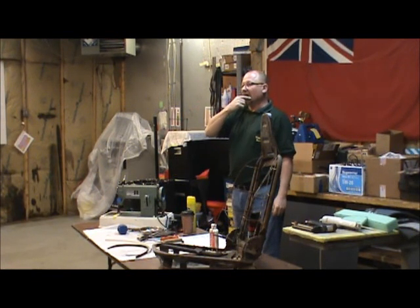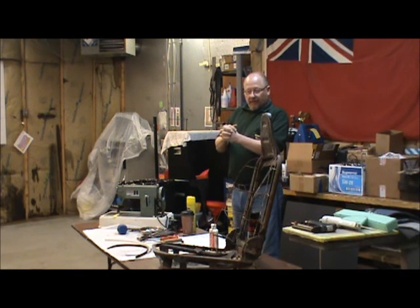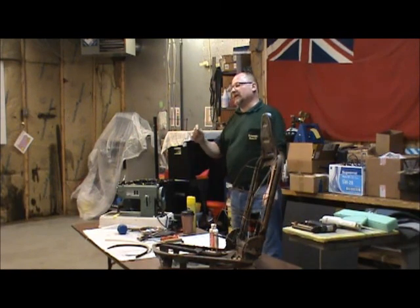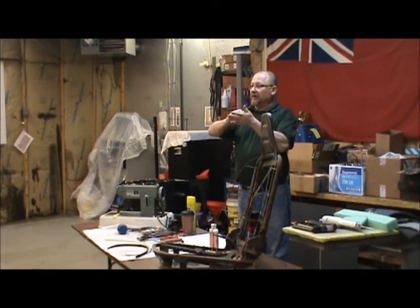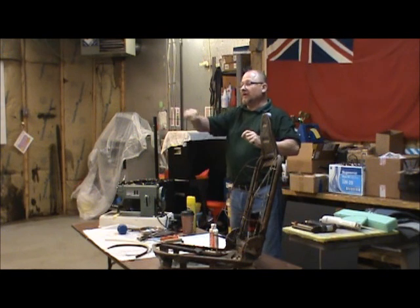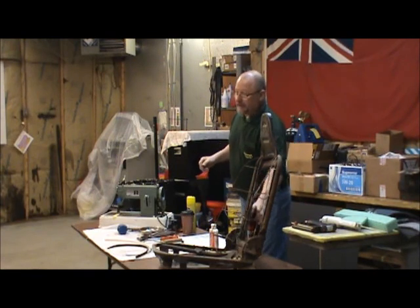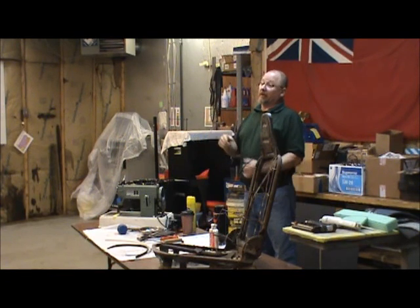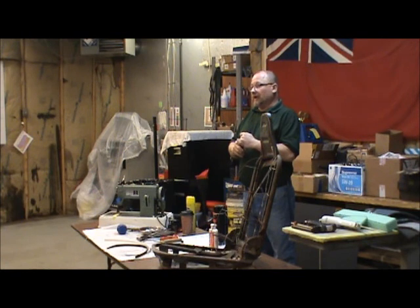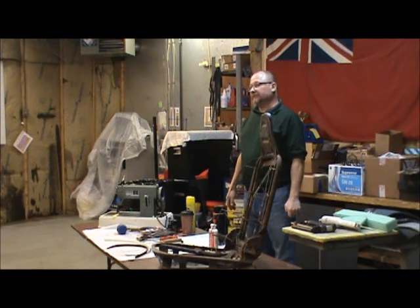Sir? Is there a vinyl glue that you can use on small tears? Vinyl to vinyl? Yeah. There is. 3M makes a product that's black. It's for putting trim on your car, like the black trim that goes around newer cars. It will go vinyl to vinyl, because a lot of times if we use a 3M or Landau top, it won't hold on to vinyl. It will just want to pull apart. So you can get that at an automotive store. You put a bead on both sides, wait till it sets up, and then it should hold together for you.